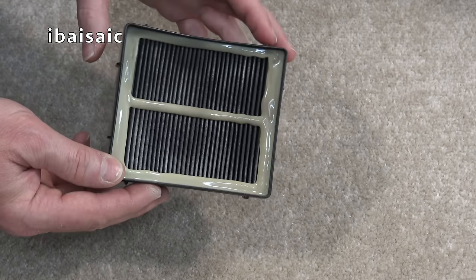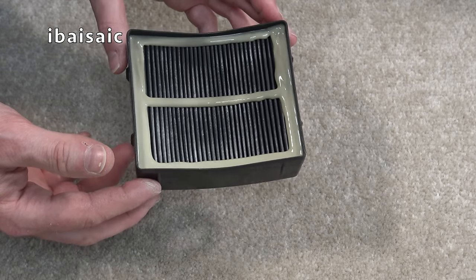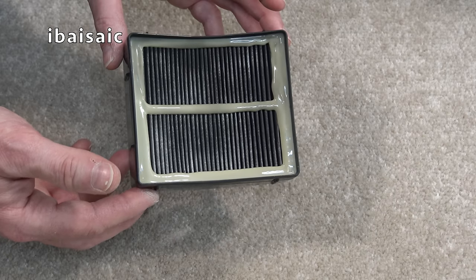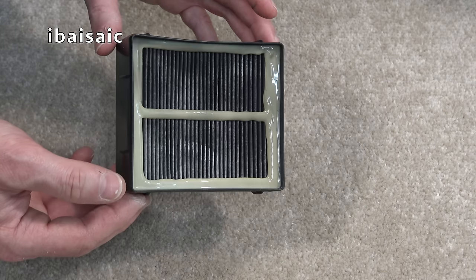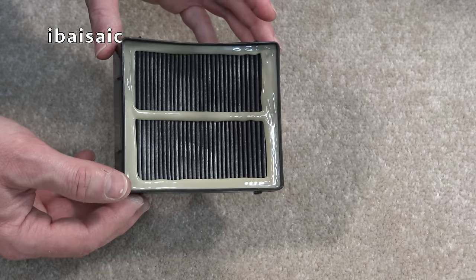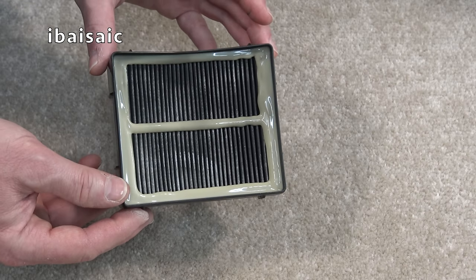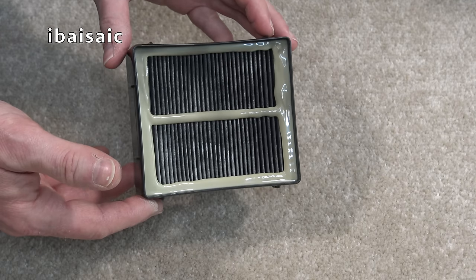On the back of this filter you can see it's gone black, but that's due to the carbon dust the electric motor produces rather than dust passing through the other filters. If you want to wash it, you can wash it under running water, but because it's pleated it might take quite a while to dry — so leave it for at least 24 hours. If it's very dirty, use a little bit of detergent, rinse it well, and leave it to dry. You might find it doesn't come completely clear, as it's very hard to remove all the carbon dust from these types of filter.